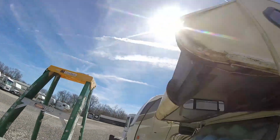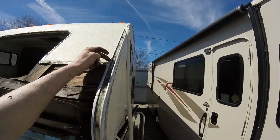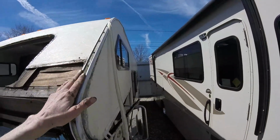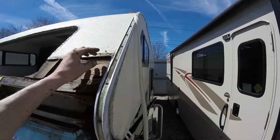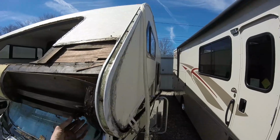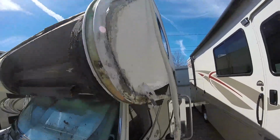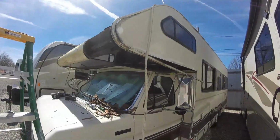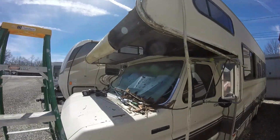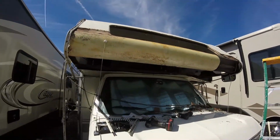We discussed taking this trim and cutting it and just making a seam, that way it doesn't have to come up all the way around the top. And then I can take this piece of trim and the trim from the other side and the small pieces that go across the front home tonight, clean them up, repaint them, get them ready to go back on. And when it goes back together, we'll use some seam sealer on the inside, seal everything before the trim even goes on, and then use seam sealer on the trim, so when it gets pushed up into place it squeezes out, fills all the cracks, and doesn't look like a gob of caulk, a Band-Aid Mickey Mouse deal.